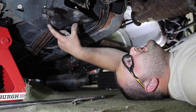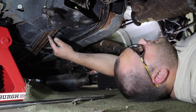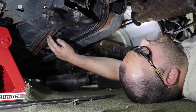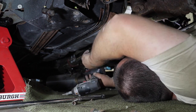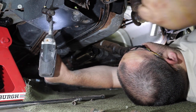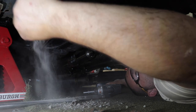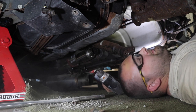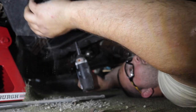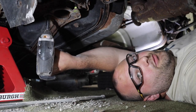Here is where it's about to get real messy. Got to take this plastic cover off to remove this horribly rusted subframe connector, and then we can undo the subframe bolt right here. These subframe connectors are so rusty they might need replacing. There are two screws here - those were 10s - then two 12s. Let's see if these will come out or break.